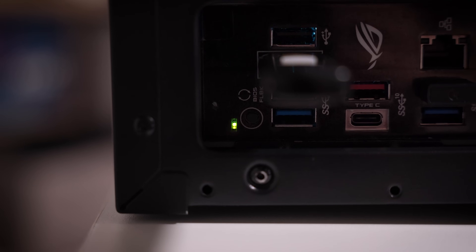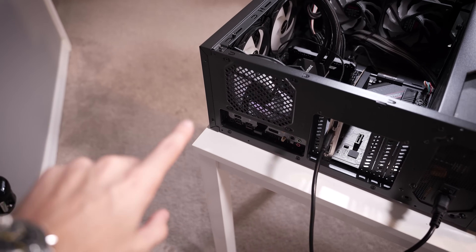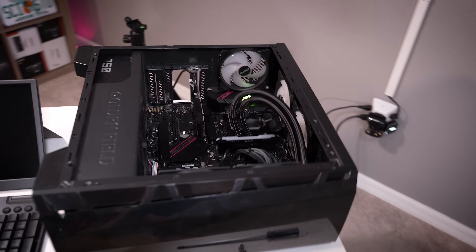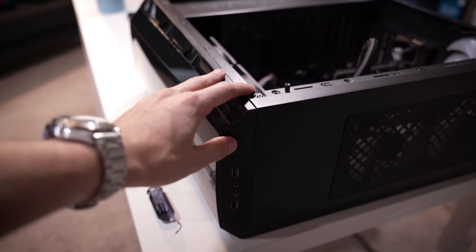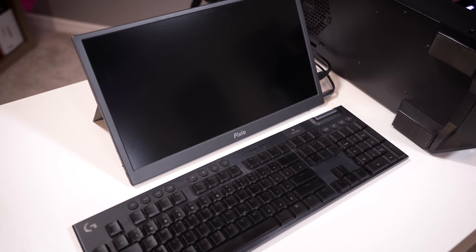While this is blinking fast, do not touch the rig, do not do this during a thunderstorm — just let it play out. Trust me, you'll thank me later. And it stopped blinking. I've got the thumb drive out. By the way, we could have done this without a CPU installed at all, which is really cool — it's a really cool feature of BIOS flashback, and we have a dedicated video on how to actually do it step by step in the description. Let's go ahead and power it up now and just verify that the update stuck in the BIOS. And there we go — that be it.